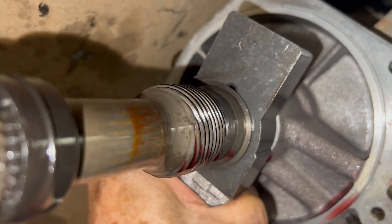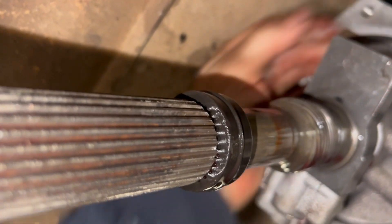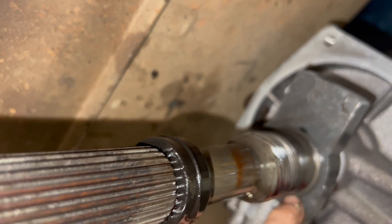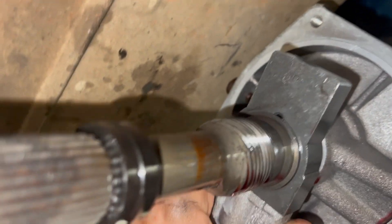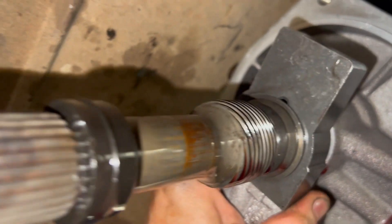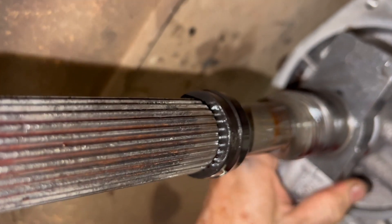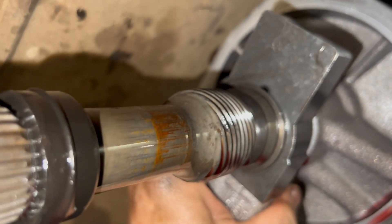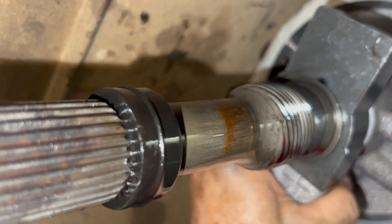The governor is moving around the shaft, so yeah, that was definitely loose. I'm going to pull a snap ring off and pull that out. There's a little trick where you can shim up behind the little ball bearing that's in there. It could be losing pressure there. It just seems kind of crazy the way it went from shifting perfectly to just not at all.